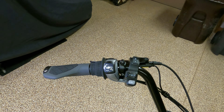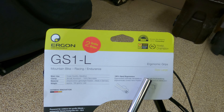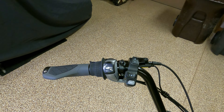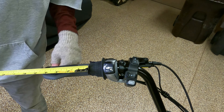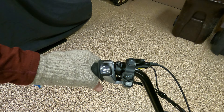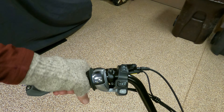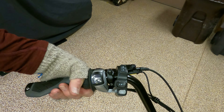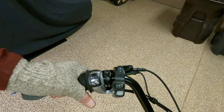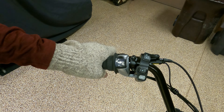The shortest cable I've got to work with is actually my shifter cable — I didn't change that out, it's a little tight. I may change it out, I may not. I put these new Ergon grips on — they're about $35, they're German, I love them, very comfortable. I did have to cut them down, just like my other $5 grips. I'm at four and an eighth inches long here. That fits my hand — all of my hand. The palm of my hand is on that rest, I've got access to change speeds, and I've got two fingers on there, which is all you need.